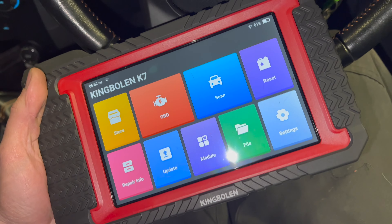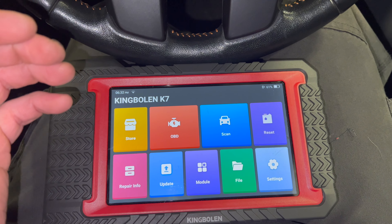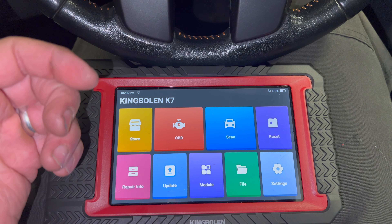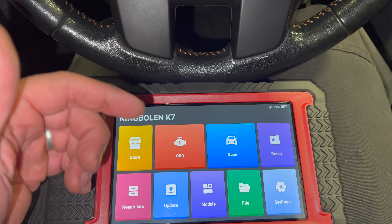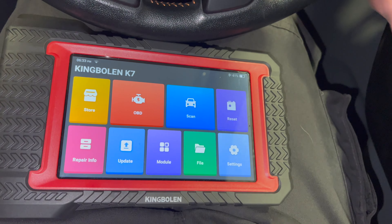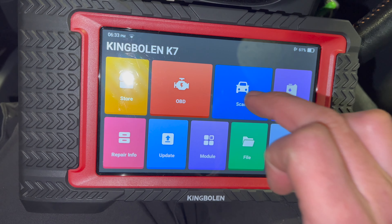It's quite a nice piece of kit to use — a decent size. I've used it on quite a few vehicles now and it's proven to be a decent bit of kit. It's got all the same functions as some of the top-end machines — it's not just a code reader. You can read all the live data, do DPF regen, injector coding, see all the ABS and speed sensor data, and it even has brake bleeding procedures through the ABS ECU. We've got the dongle plugged in, ignition on, and I'll run you through doing a main scan rather than just a straight OBD scan.